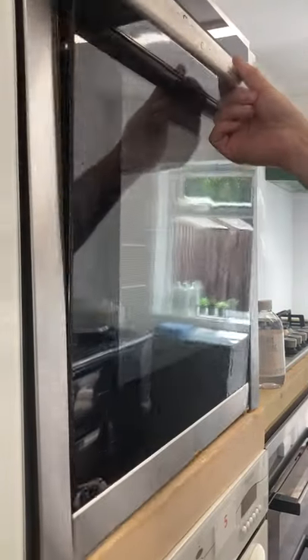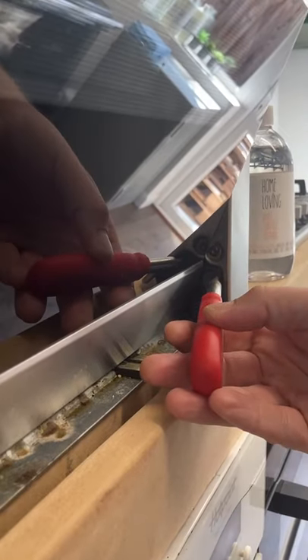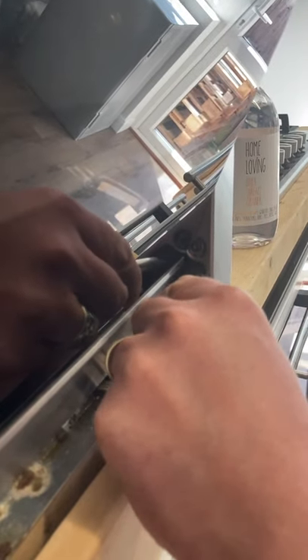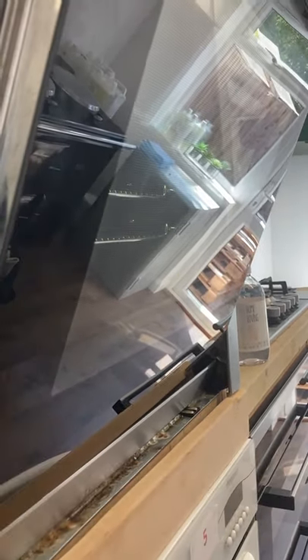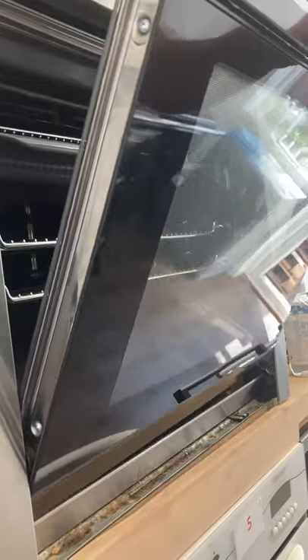So how do we get the door off? First of all we open it ever so slightly and we turn a screw — you have one on the left and the right-hand side, little plastic screws. We get a larger screwdriver and turn that screw towards the oven, and also the one on the other side in exactly the same way. That locks the door in position — give it a little wiggle, there should be a slight click. If the door continues to slide, close it ever so slightly, give it a wiggle, and it should lock in place.